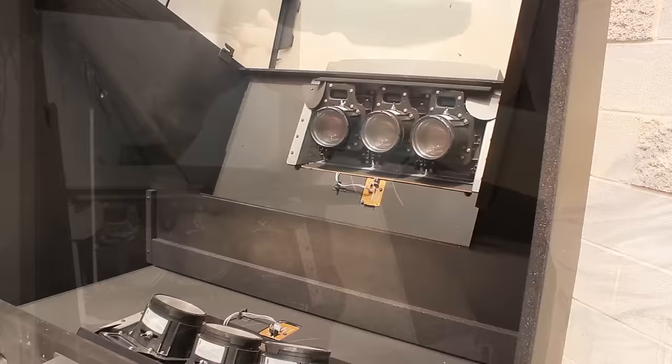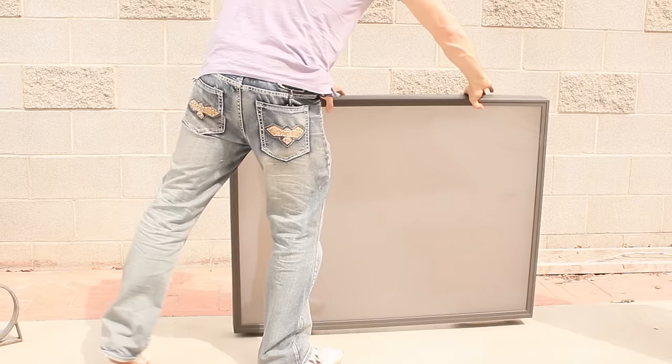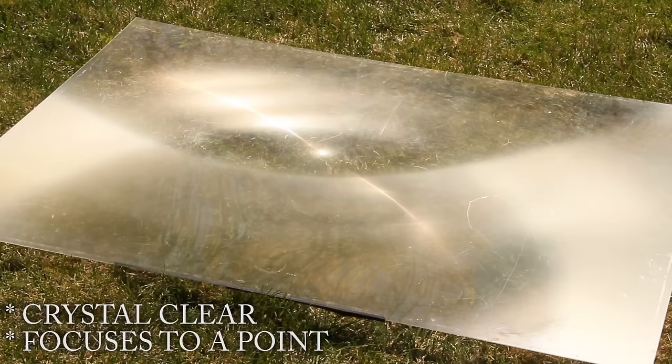Now since this mirror is used for projection, it's super reflective, so I'm going to remove the screws holding that in place and save it for a different project. This TV screen has 3 separate layers. The front layer is a large piece of plexiglass that can be useful. The middle layer is a vertical lined plastic, and this back piece is a giant Fresnel lens — this is the piece that I'm after. I got lucky, because this one happens to be a crystal clear lens that focuses to a point. It may not look like much, but this is a giant 4 foot magnifying lens.